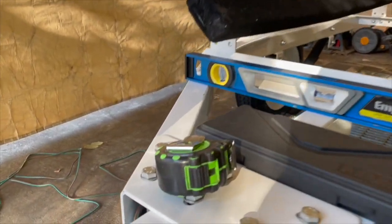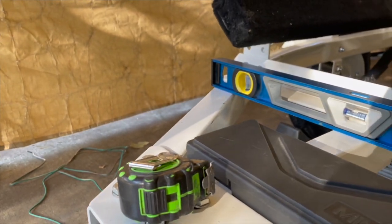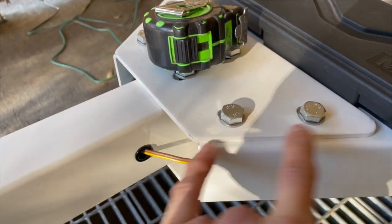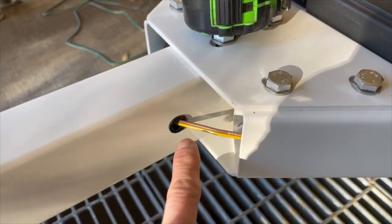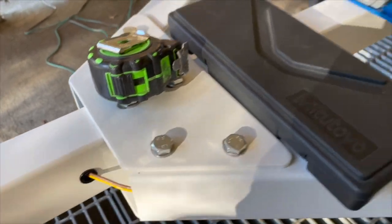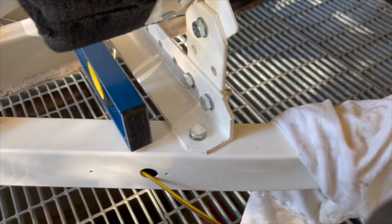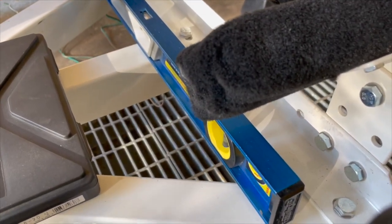Same with right here too. This area right here, the bolts are potentially going to rub against the bolts down in here. Obviously I have a little grommet insert here that will help protect the wires, but I'm going to heat shrink this section as well, and again over here, and wherever I think there's going to be rubbing, I will heat shrink.